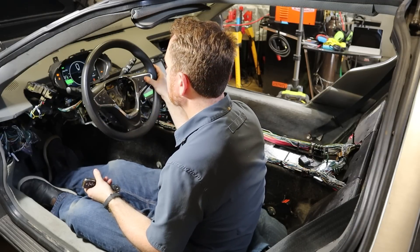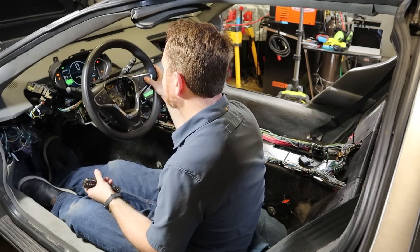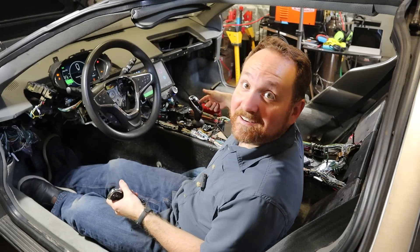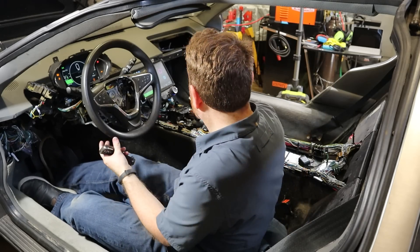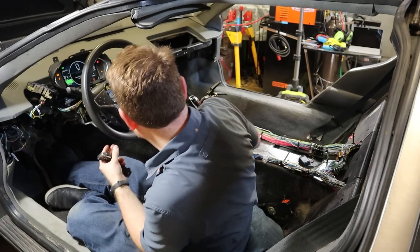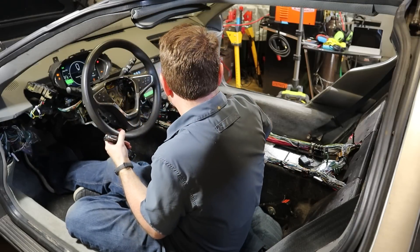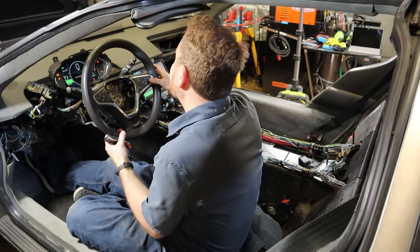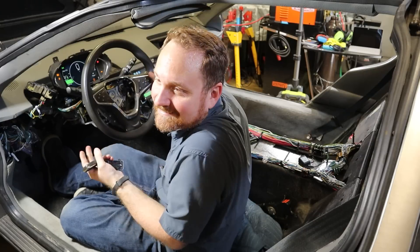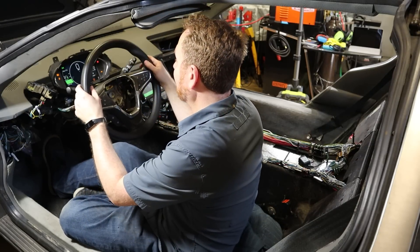Safety restraint system. Service vehicle soon. Parking brakes. Steering assist is reduced. Pedestrian friendly alert. The lights came on here - that means the CAN bus is working. I'm just going to full send. My wheels are up on things here, but I'm going to hold the brake. I have brake assist now, so that's great. Put it into drive. 'Conditions not correct for shift.' I kind of expected that. I'm actually very surprised that I've even gotten this far. This is fantastic.